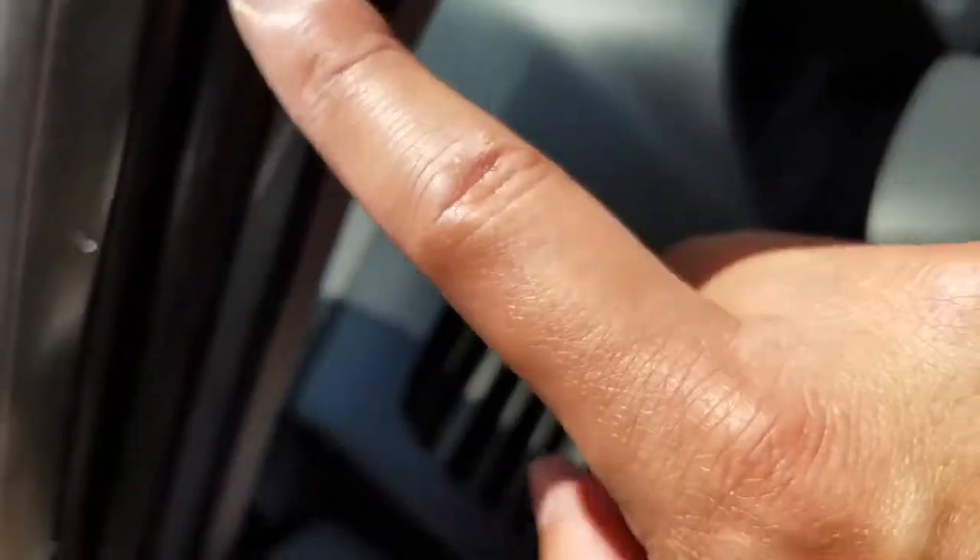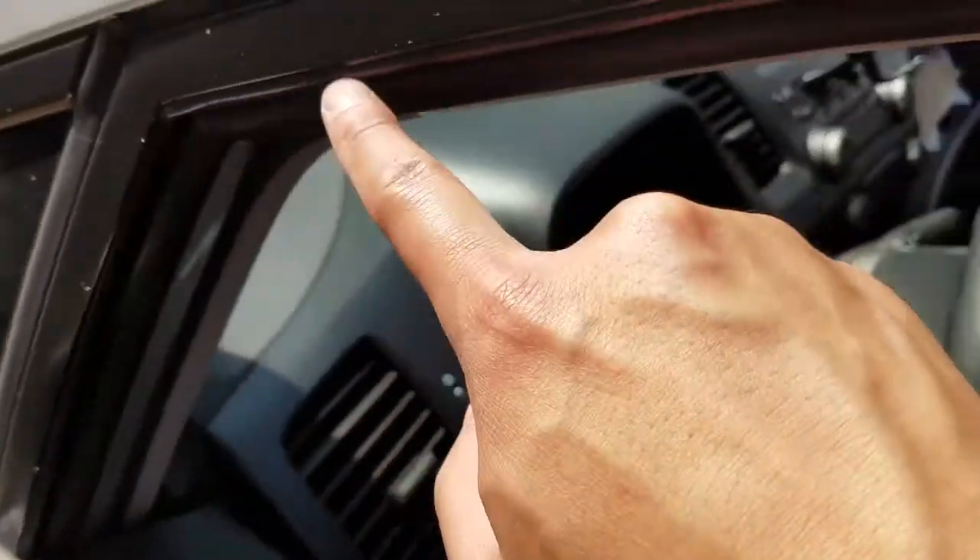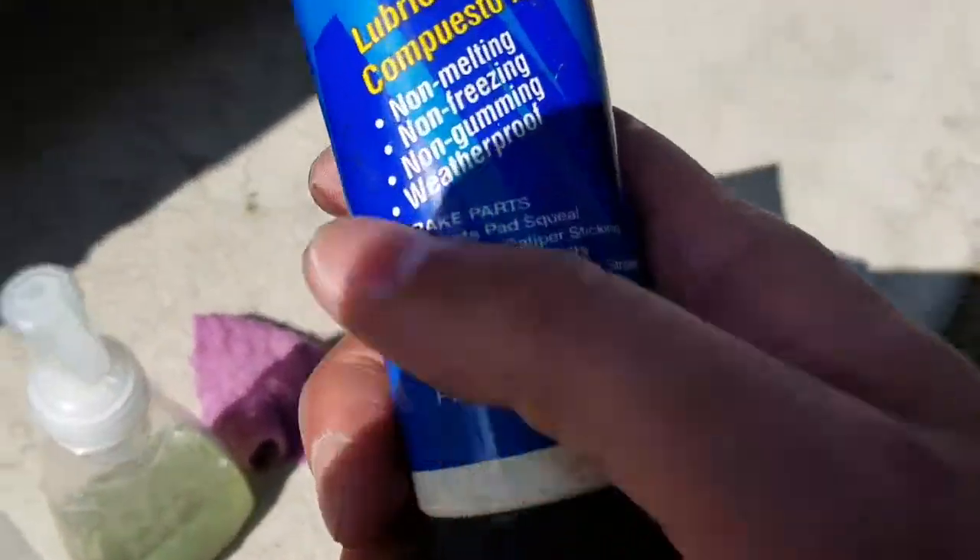On this side you can see the track — the grease gets old and sticky. This is something you have to do pretty much every one to two years. All you need to do is put new silicone grease on each end of the sides. Do not put it on the top — just on each end of the side. It helps guide the window right through.